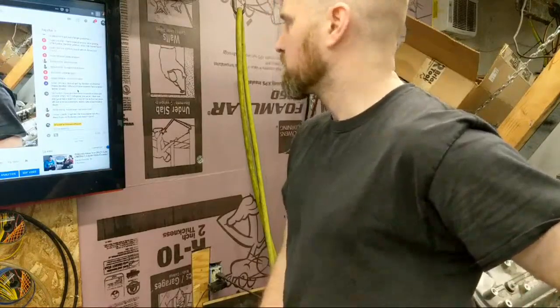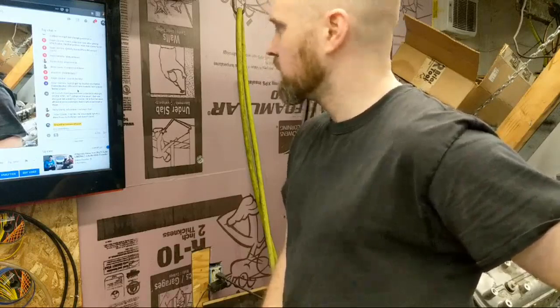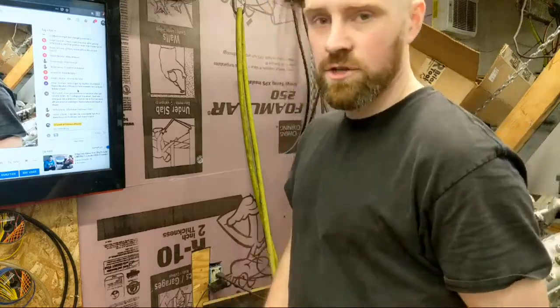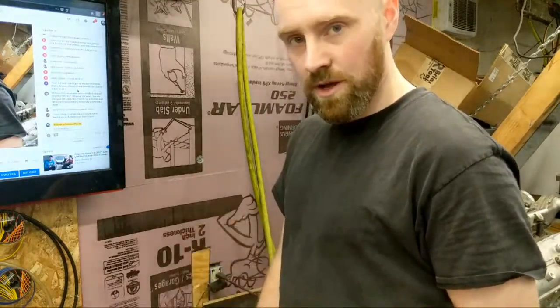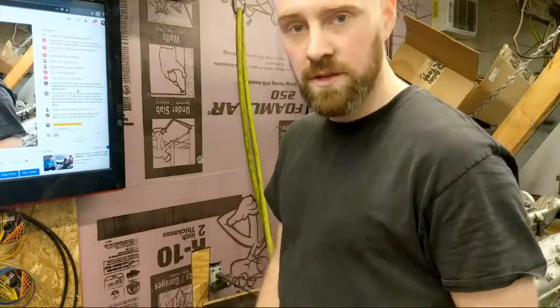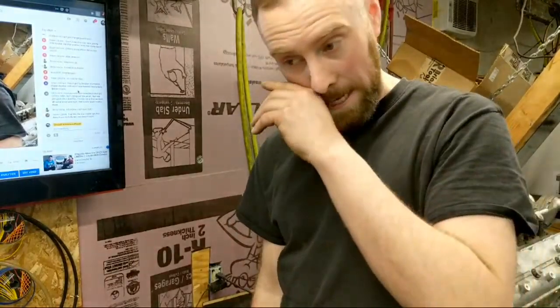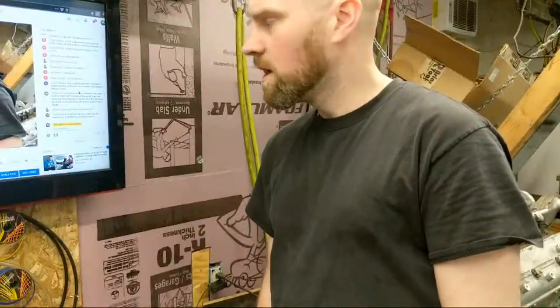Okay, Adam Holmes talking to Ricky, but he says, I got a disabler from Amazon, a Diablo disabler. Now, those disabler units, Range, Diablo, things like that, they work as long as your VLOM is still plugged in. I believe they cause problems if you unplug it or gut it. I recently had a guy saying that he did that and he had the disabler and his computer wasn't allowing full throttle. It was acting like it was in limp mode is basically what he was saying.